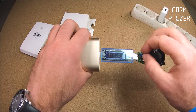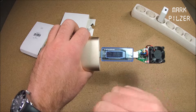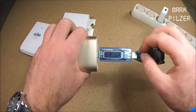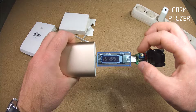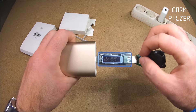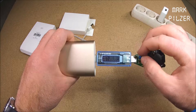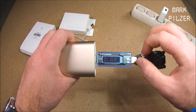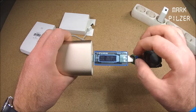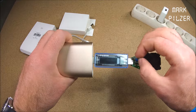Apart from the power bank itself, there is a small micro USB cable included. The cable is quite nicely designed, but there is a downside to it. It's not that it's short — it's actually nicely designed — but I've had some issues with this cable. It doesn't seem to handle as much amperage as 2A. When charging with my Li 202 I had issues getting even 1A into the charger. It was always failing, and once I swapped to the original cable for that device it worked. So I believe this cable isn't as good as you might think, although the design is nice.